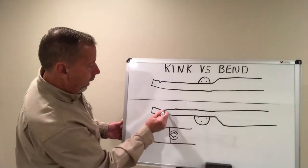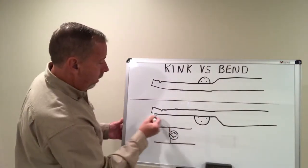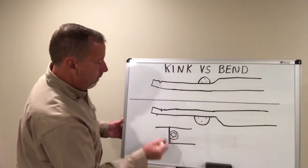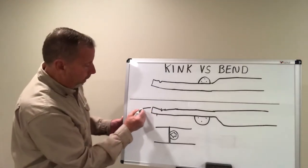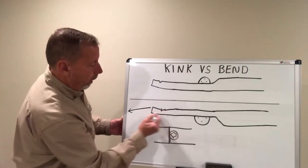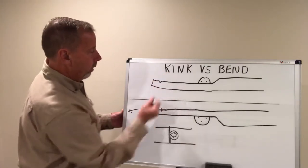It could be right in this area or up here depending on where it falls — that was an option. A lot of times what I've done: if this area was salvageable and you only needed to put the inner in, I'd make a cut through this kink up and down to relieve the pressure and stress from that buckle, then do my pulling. Put my forward pressure on there — that takes the kink out of the equation, takes less pressure to straighten it, this panel can be salvaged, and you can just put the inner one in.